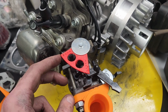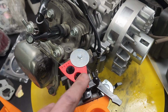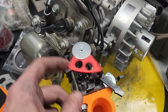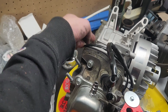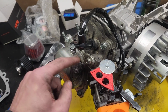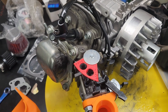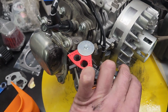Obviously, this is a prototype, and it's just done in plastic to make it quick. Eventually, this will be a piece of like 1/4-inch thick aluminum. But as you can see, the throttle pulls this direction and goes like that. Almost everybody taps a return to come to here on the racing engines. So going to there is easy enough, just put a loop in a spring, and then your throttle would pull this direction across the top. Now, I've got to make the piece that goes there so that my choke is in place.